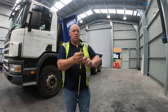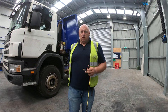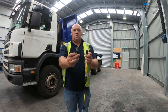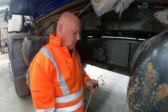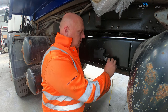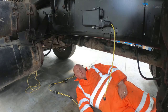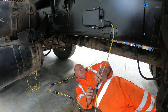In this example there are eight sensors on the vehicle. When you reach the final Y splitter, connect the CAN terminator to one of the ports. Next, connect the grey plug on the sensor input cable to the grey port on the junction box. Connect the other end of the sensor input cable to the pre-assembled internal domain cable.